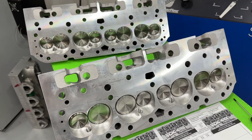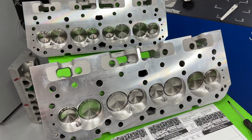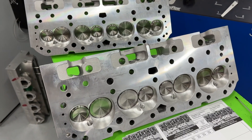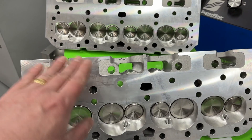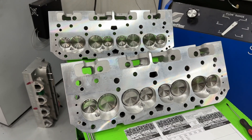These are the street version, not the race or competition version. The porting program is different for each — they actually have a 195 that's competition-spec, with a bigger intake valve and a different port design that does move more air. But that's not these. These are the exact same street port heads, which retail for about $2,080.